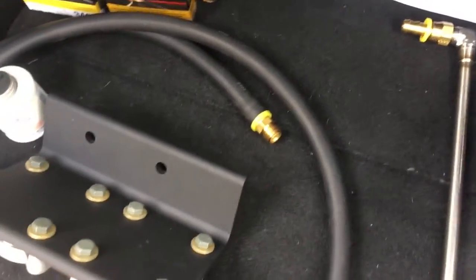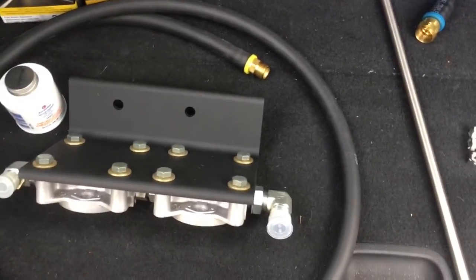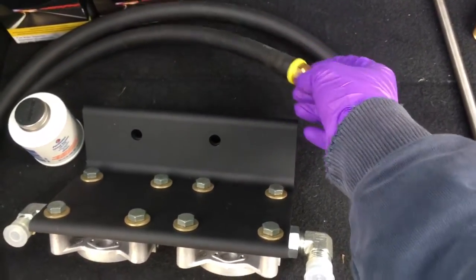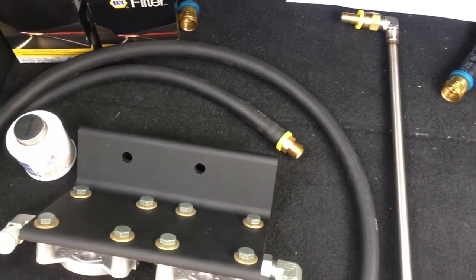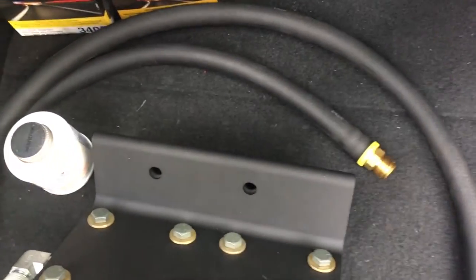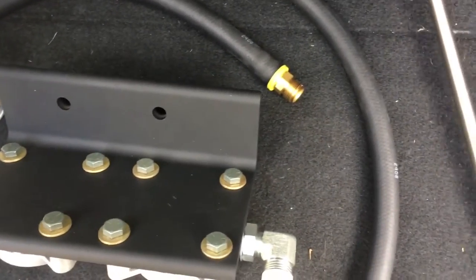This is your leader line from the housing to the pump, and then this is your line that replaces from the housing back to the fuel tank. If you buy Ken's kit, it comes with the male fitting for the tubes that are already on your truck — the military ones. If you buy Ted's tubes and plan to replace the fuel tubes, you'll have to measure and then end up cutting it square and replacing it with this connector here. This will push into the tube, seat in the tube, and then attach to the new fuel tube.